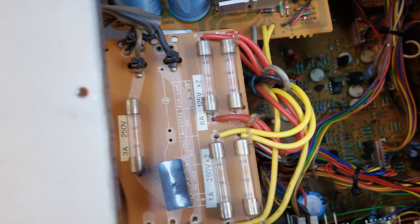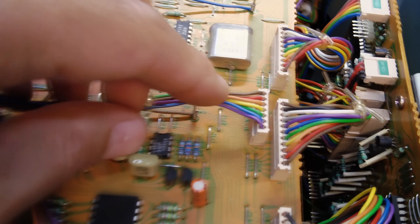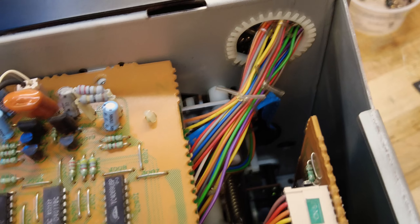As mentioned, that is the power supply — a fairly well-sized power supply. That'll be our first bit of troubleshooting: testing all the voltages right there at those colored wires. The fuse block is here, with fuses for different voltages and protection for different parts of the power supply. Another neat thing is that they've taken care to label all the connectors — here's CN41. The schematics always refer to connector placement, and rather than cross-referencing a schematic, they've labeled the wires themselves. They've also protected this pass-through with plastic so the wires don't get frayed. And look at that bundle of wires — you can see why repairing these machines is so costly.